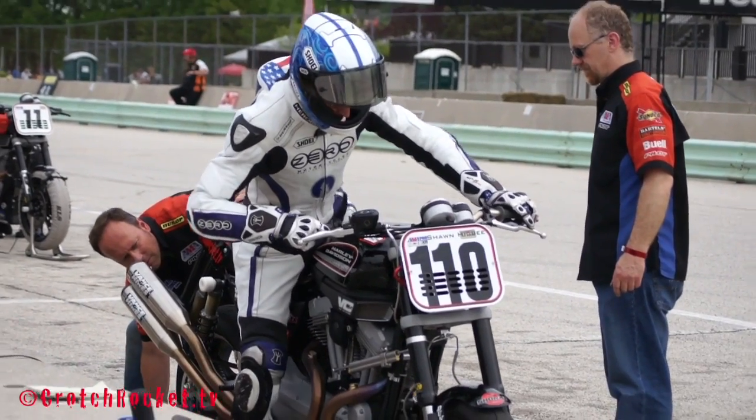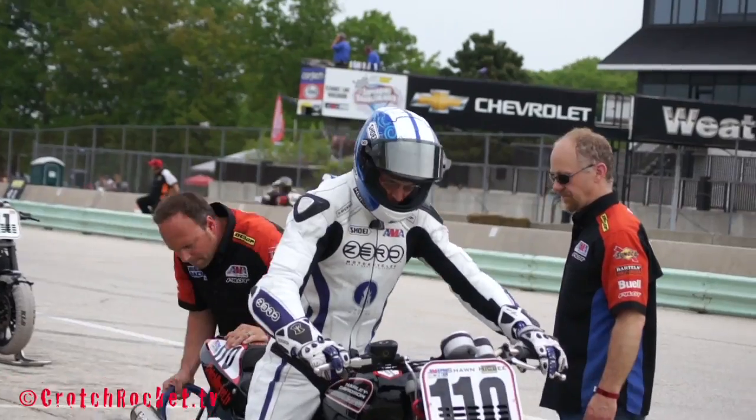Right. Well, exactly what you said. We were at 1.5, we went to 2 on compression, and then I put 2 more clicks of rebound in it. Okay. Adjustments made, it was back to the track for more testing.